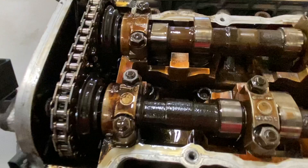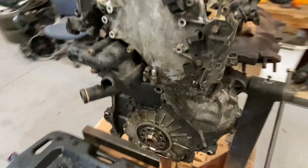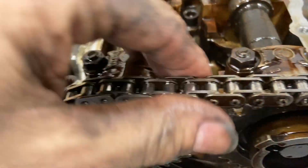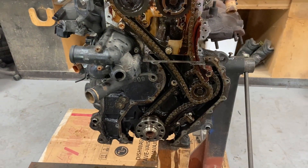There's just no good way of doing this without making a mess. I got the valve cover off and the cams are absolutely beautiful — super beautiful cams, so that's good. I'm gonna start pulling this front cover off, get the chains undone, and pull this head off hopefully. The chains looked good, nice and tight. Had great tensioners and rollers on it until I pried the cover off and kind of cracked this one here. But other than that everything in here looked really good. It's a shame they ran this thing out of oil — it was a good motor, it would have lasted a long time.